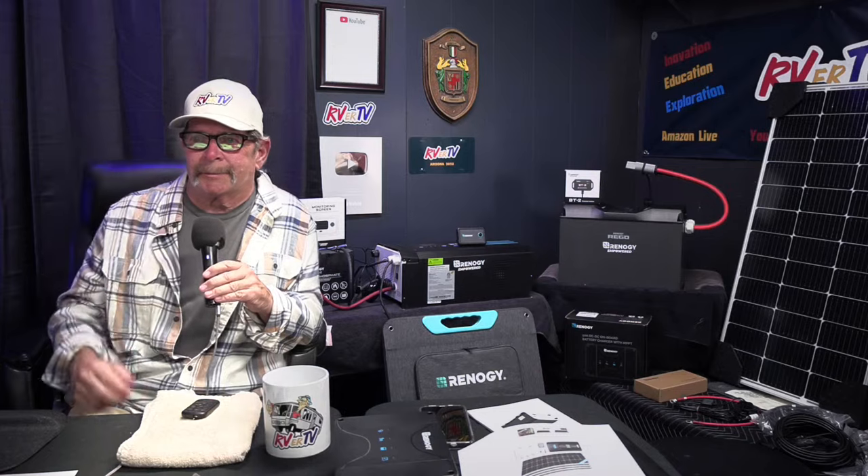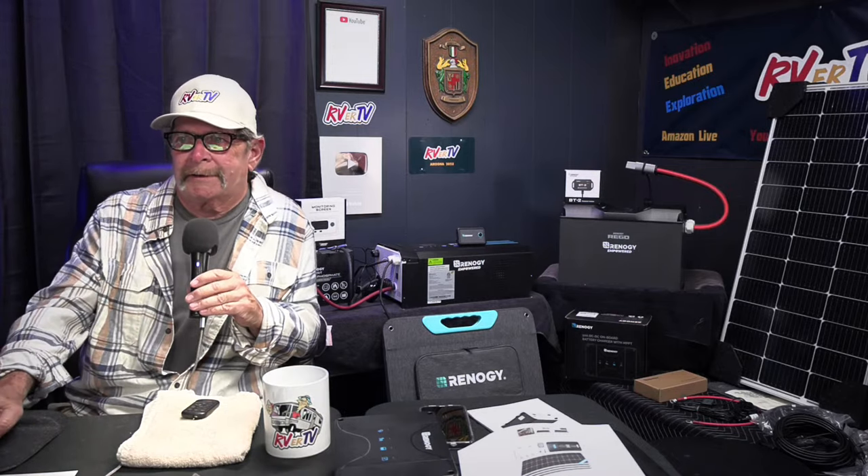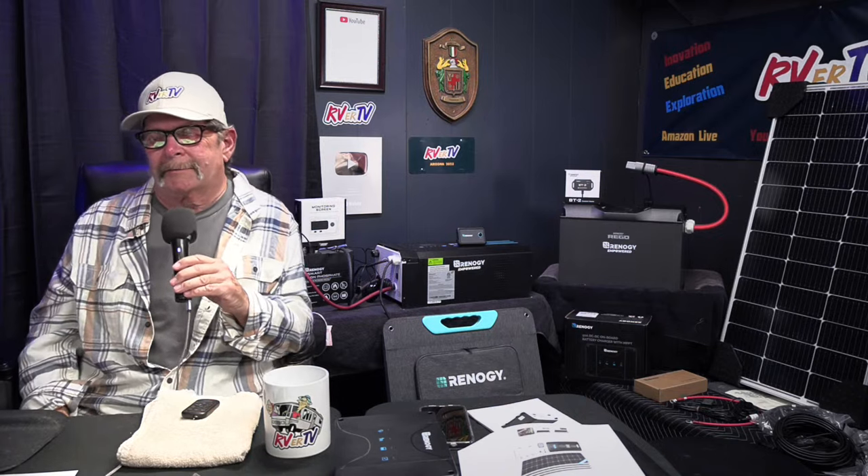Even in your home in a power outage, you see it all the time — people buy generators and run out of fuel. The sun is up every day. In a power outage that could go on for weeks, if you're very remote you can still power everything. I run my Starlink off the Renogy solar panels and inverter in the van every day on the road. The Starlink draws about 30 to 40 watts — it's a constant draw; you can't turn it off or you'll lose your internet.